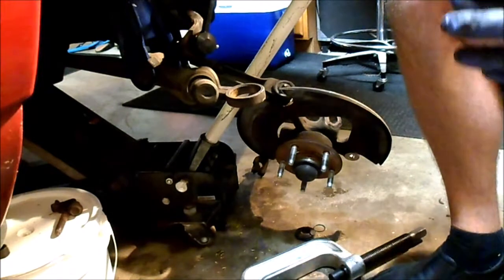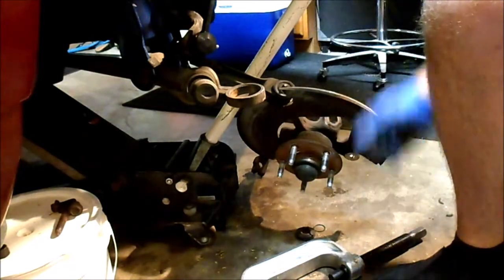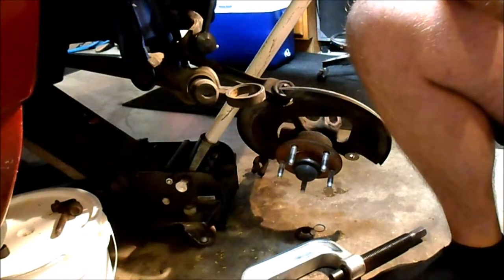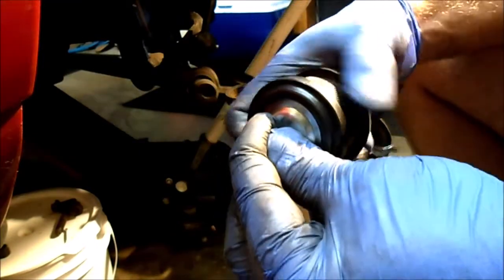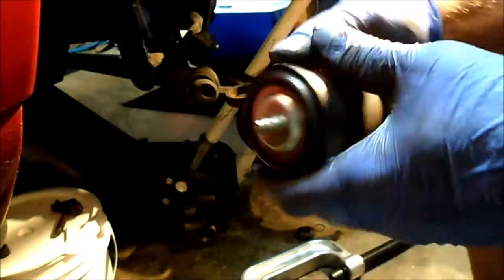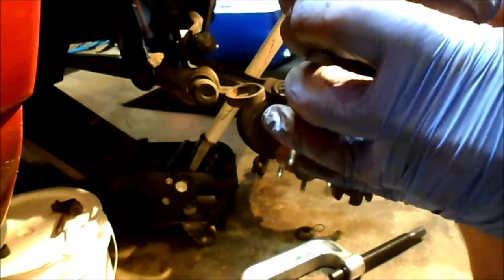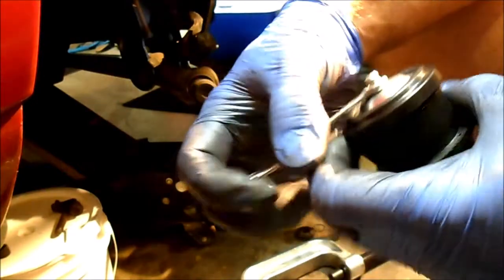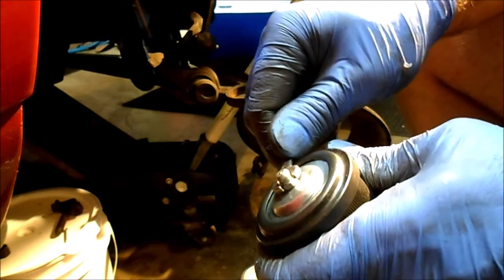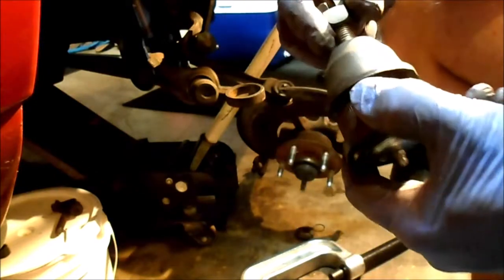The other one's going to go right up from the bottom — stay tuned. The new one's got a grease fitting on it that I'm going to put on there with a little 9/32 wrench. Just snug it on there — no need to torque it on like crazy, just nice and snug. Then I'll take this boot off and the crown nut off and she's ready to install.